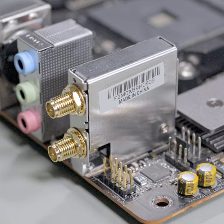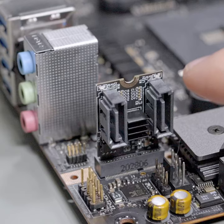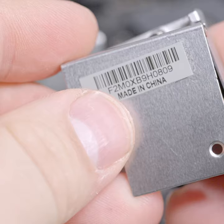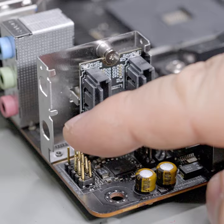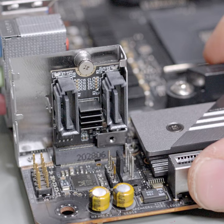Recently I did a video showing off alternatives for the M.2 Wi-Fi slot. It turns out that if your motherboard has one of these little boxes, it's actually an M.2 slot — you can't put an SSD in it. I had to take off the VRM heatsinks to get to the module, and you have to take out two screws at the bottom. Once you take the screws out, you can take the whole module apart and reassemble it with the new card. Leave the cover off if you've got external connections, and you can remove the antenna cables since they kind of get in the way — then you've got access to all those options I showed in the other video.